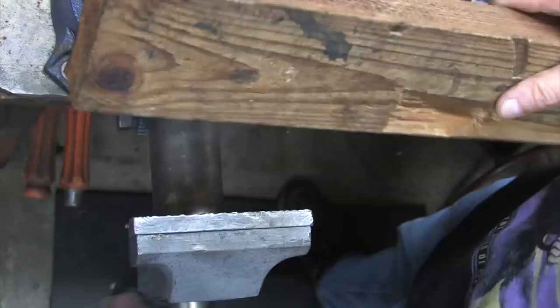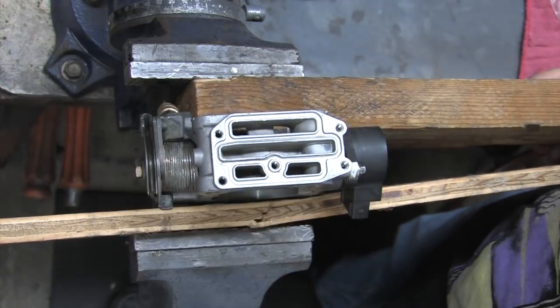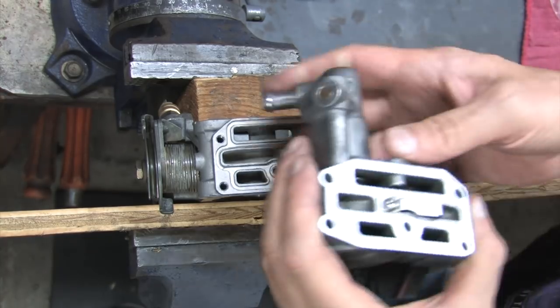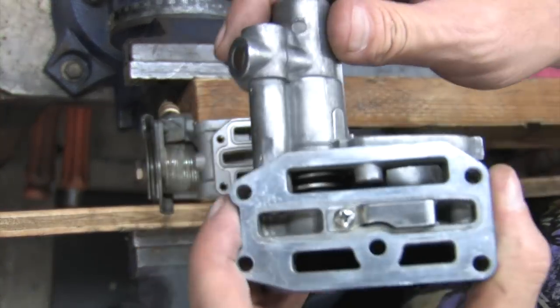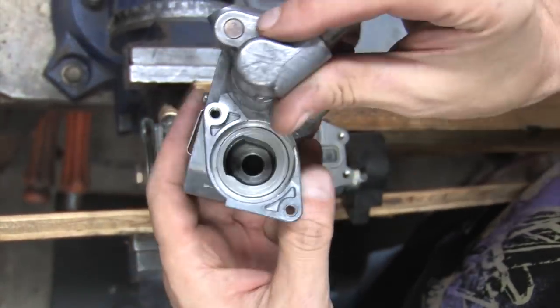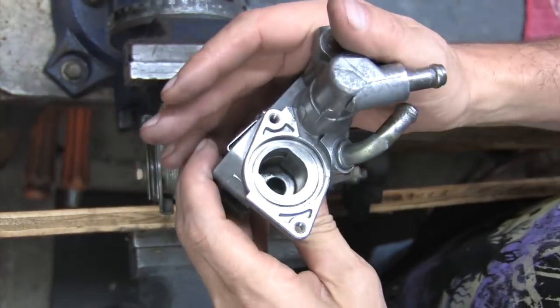So now let's talk about this fast idle air valve. The fast idle air valve is a thing in every DSM throttle body. When it's cold, the valve is open to make your car idle higher and to make it less likely to stall until it's up to a stable running temperature. It relies on coolant temperature to close an air bypass valve. You can see the idle speed controller motor is also part of this assembly as well.